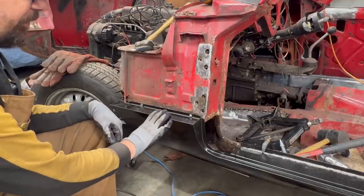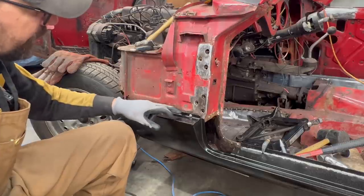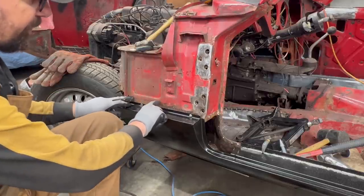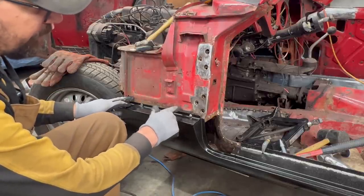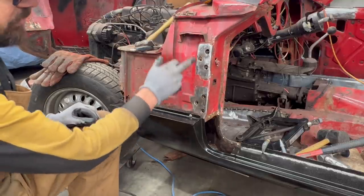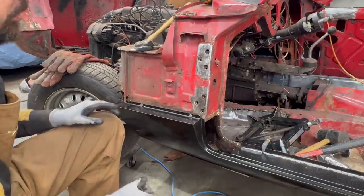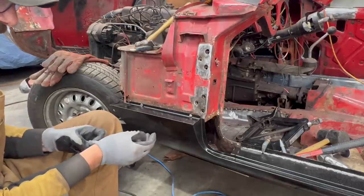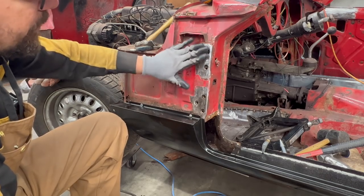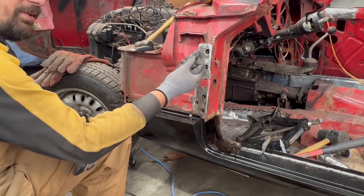I'm going to take this seal out and I'm going to clean this area to see how far up I need to go with the repair. This metal here is pretty pitted, so I think I'm going to replace it at least up to the pressings here. I'm going to go down under this pressing because I don't want to disturb them, but we'll see. I'll clean it up first. Some people mentioned about these surfaces here that they are pressed in — and yes, they were pressed in. When I read the comments on YouTube, I realized that I didn't show this repair. It was pushed in, but I pulled them out, so now they're in the right place.